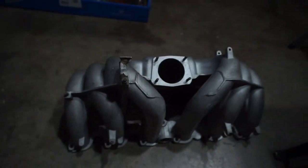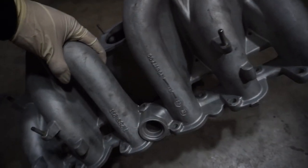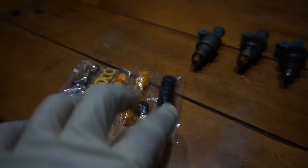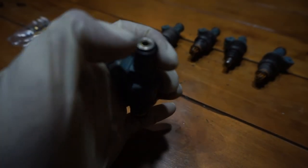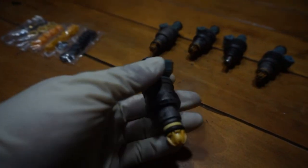Last time I was filming, I ended up taking the intake manifold off because when I took off the injectors and the injector rail without taking off the intake manifold, there was some plastic in the intake ports. So I took the intake manifold off to clean the intake ports. I threw it in the parts washer and scrubbed it down real nice. These are the six injectors — I ordered a rebuild kit, and this one here has already been rebuilt with new o-rings, a new filter, a new cap, and a plastic spacer.